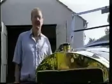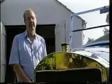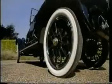So being a steam car, it has a boiler. It's a fire tube boiler with a burner underneath which burns a mixture of petrol and diesel. Like your gas boiler at home, we need a continuously running pilot light. Therefore, underneath the boiler is a small pilot assembly which runs on hexane fuel. That's kept in a tank underneath the rear seat.